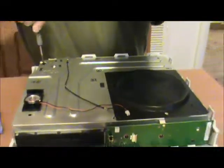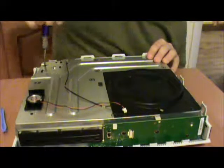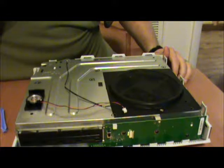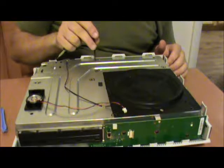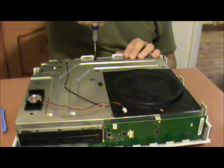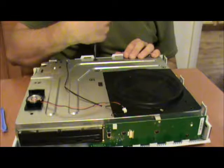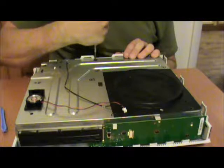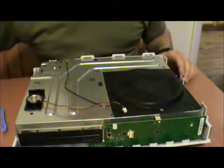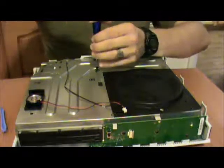Try to zoom back out. When you're bolting it back in, the screw points are going to be slightly weaker than what they were when you initially pulled them out. So you want to be careful not to go too tight so that you don't strip the screw wells. Tongue twister. Had a long day. You can forgive me, right?